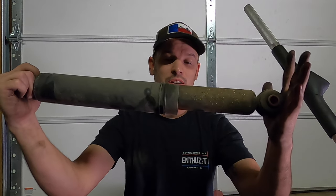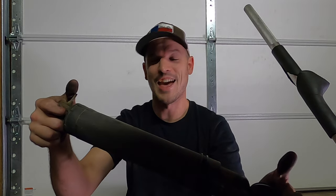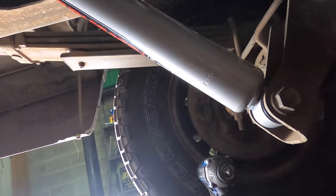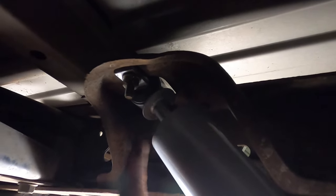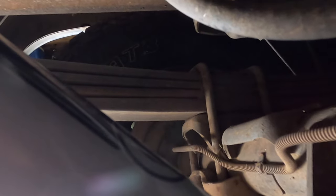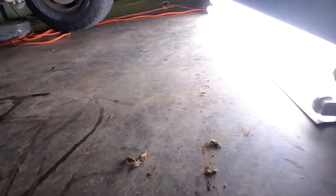There's a very good chance I'm going to install the rear lift on this thing after we get it out and check it out — probably take the drop shackles out as well. I just got done putting one of the rear shocks in and there's about an inch of clearance, so not much. Here's the old stocker — absolutely clapped out. It's just a 7/8 bolt down here, you have to hold it on both sides, and then a 14mm up top, two bolts you have to hold as well. You can see there's that much gap before they bottom out, so not much at all.